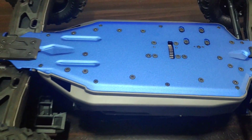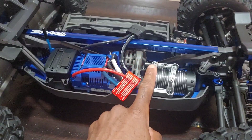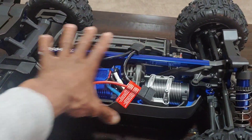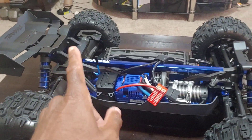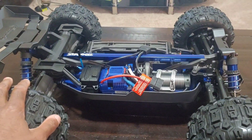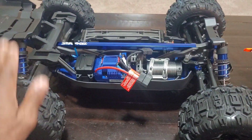I'm going to get this running ASAP. It's got a 2000kv motor and at least a 150 amp speed controller. I'm pretty much fine with the motor and ESC. I don't know how strong that servo is going to be, but the electronics and the way they gear it should be fine stock out of the box. Definitely will be fixing those rear dog bones before I do anything else - I don't want to run this and have those pop out. That's probably just something missed in production.